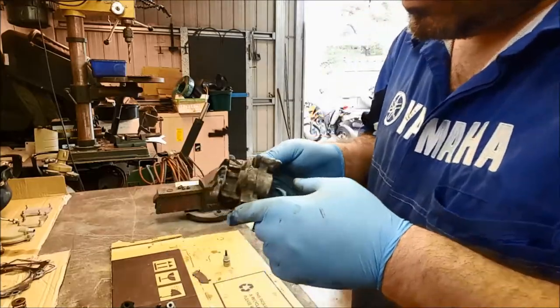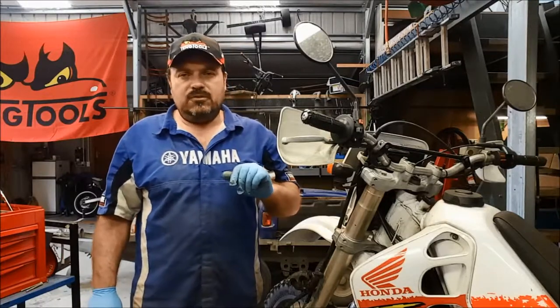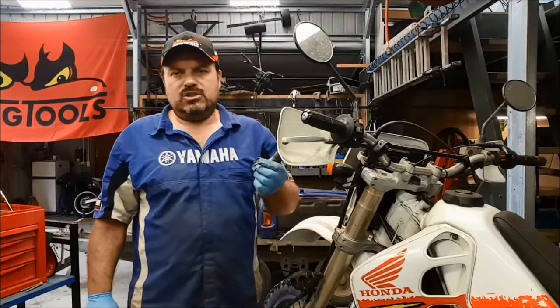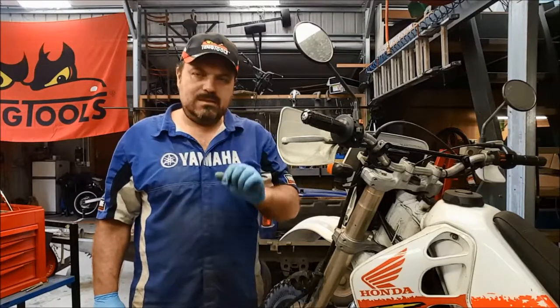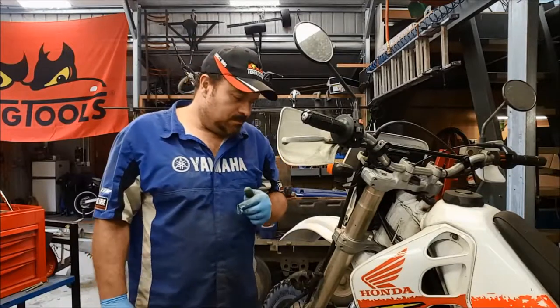Now, you've seen in the previous brake caliper strip down videos different techniques for removing the pistons from the caliper bodies. You can use a punch, depending on where the banjo fitment is. On those Nissan Patrol calipers, it was right bang in the middle of the pistons. It was really easy to use a punch to pop them out. Bit lazy, but hey, it's quick and it's efficient.